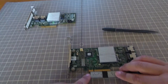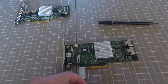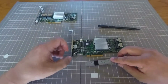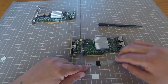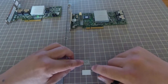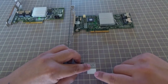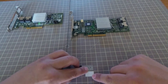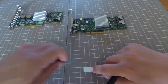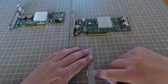If we measure pins B5 and B6, it's about 2 millimeters wide and about 4 millimeters long. So we're going to need a strip of tape that's about 2 millimeters wide and 4 millimeters long. I'll go ahead and use the grid line here on my cutting board to cut that out. I'll hold the tape down and cut along that grid line — hopefully that will give me the 2 millimeters that I need.